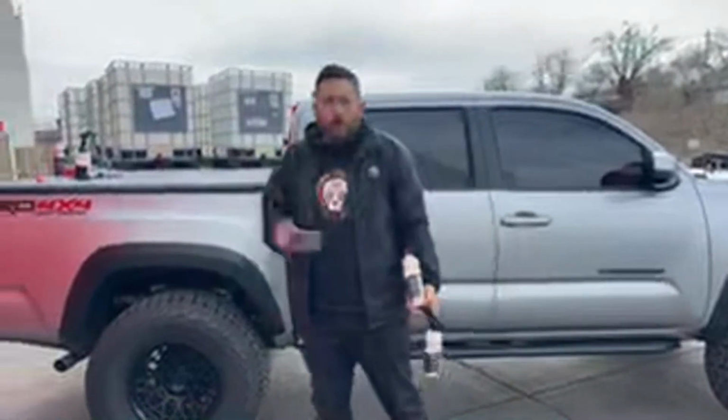If it's a little bit more performance based, I would highly recommend using our standard wheel cleaner, Adam's Polishes wheel cleaner, and then use a tire and rubber cleaner to clean the tires and the rubber. The reason is that performance cars have performance brakes, which have a lot of metallic brake dust, and our wheel cleaner breaks that down. You've seen this throughout our industry: you spray wheel cleaner on it and it turns purple. That's a raw chemical called thioglycolate, which actually breaks down the metal, and it turning purple is its natural reaction with the thioglycolate breaking down the metal. So it works best for removing metallic, heavy brake dust, things like that.